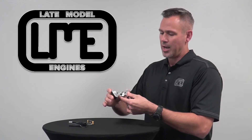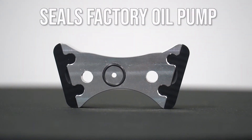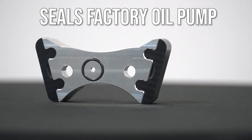So what we've developed is a timing chain guide, as opposed to the tensioner. This replaces the factory unit completely and comes with two bolts to bolt it on. A major feature of this part is that it seals the oil pump — the factory pump seals on the front and also seals to the back of the block here.